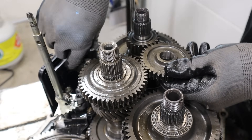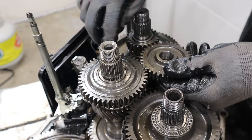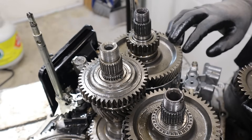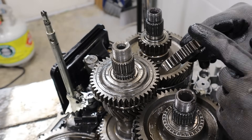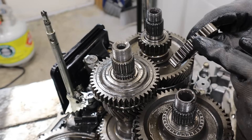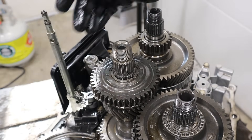When you want to switch to another gear, this releases pressure, and that's going to cause this to freewheel so you can engage other clutches to go into other gears. When you reverse a Honda with this type of transmission, it makes a distinct whirring sound like a manual transmission, because it uses the straight cut gear. All the other gears use a spiral cut gear to reduce that noise.